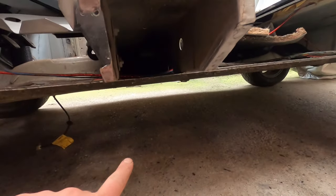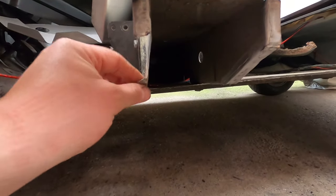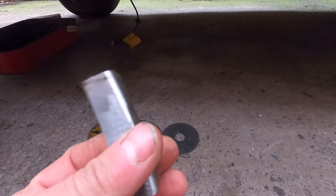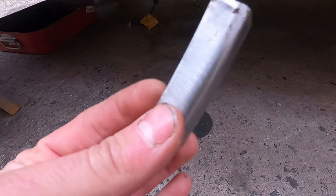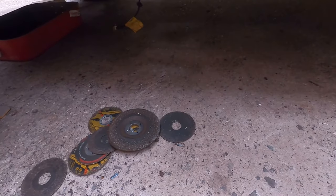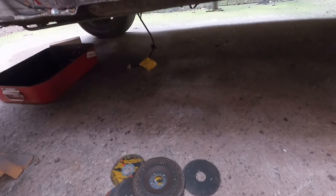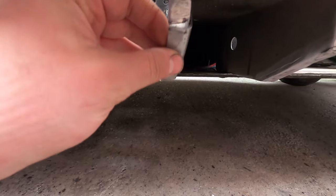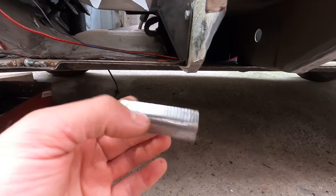We've got the box section here — everything's trimmed out of it now, everything's cleaned back. This is all really decent, but we're missing a massive chunk of it there. One thing I always say is never throw away off cuts from your panels. This is a bit of an inner wing of a Volvo Amazon — Volvo saves the day once again. It almost fits perfectly. We'll go in there and that will go in there lovely. Don't ever throw away your off cuts — put a little bin aside with all your panel off cuts. I haven't had to make anything, all I've had to do is trim it. It's done. So what we're gonna do is get that welded in.